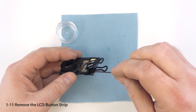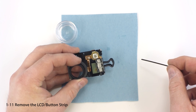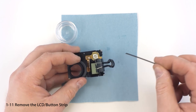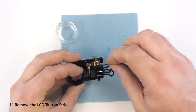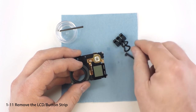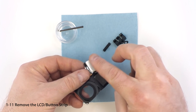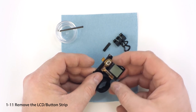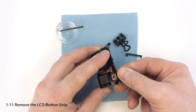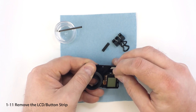Apply a few drops of alcohol under the top right corner of the LCD display. You should notice the dark patch on the screen slowly fade as the adhesive releases. Add more alcohol as needed. This step is usually fairly quick, however on rare occasions the LCD may require up to 15 minutes before it fully releases. Never attempt to force or pry the display off. Remove the clamp and plastic parts, then gently lift the LCD display to verify that it's free. If the LCD remains stuck, even slightly, it's best to use a little more alcohol and wait for it to be completely free before attempting to remove it. Gently peel off the lower portion of the button strip, taking care not to tear or bend it sharply. Wipe off the remaining alcohol — the rest should evaporate after a few minutes.